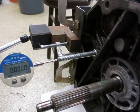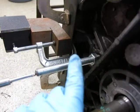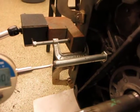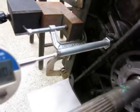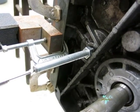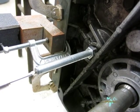The next step is to partially assemble the transmission and set the clearances for the main shaft, the input shaft, and the counter shaft, which is behind that, and the counter shaft extension. The manual says to do the input shaft first, but I think the better wisdom is to set the counter shaft play first — this has been discussed on the forums. Since the counter shaft is advised to be set to a preload, you're better off setting that first, then coming back to the input shaft which is supposed to be at a clearance. So I'm going to go with the counter shaft adjustment first.